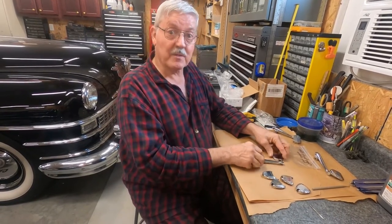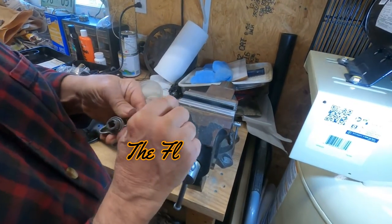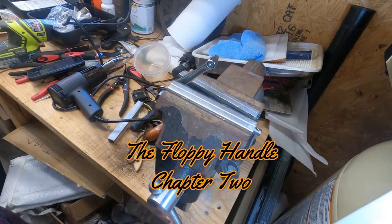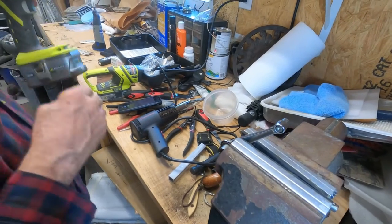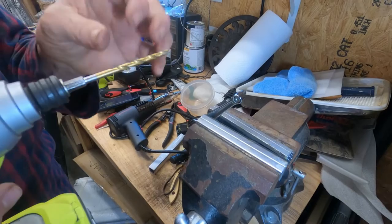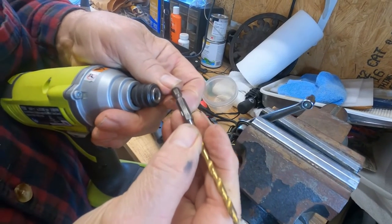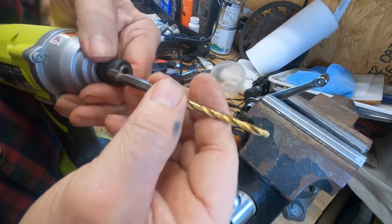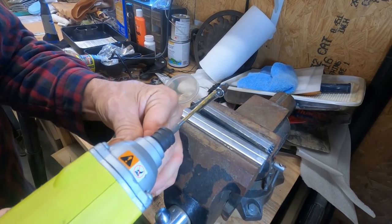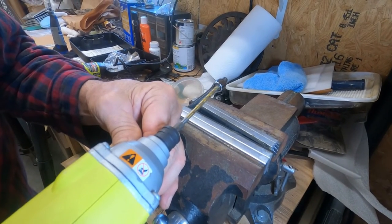So that's how you take one of these floppy handles apart and put it all back together to make it look like new. I said Dremel out the edge with a grinder, but what I'm going to do is put it in the vise and use a drill. I've got an 11/64ths drill — not too big, you can see the size — it's less than the diameter of that ring washer. Specifically it is 11/64ths; probably an eighth inch would work too. So get this at slow speed and start drilling out right in the center. I'm thinking this will work.